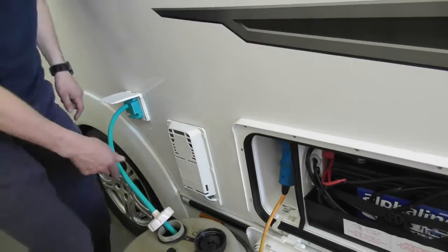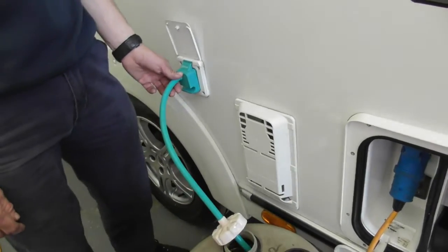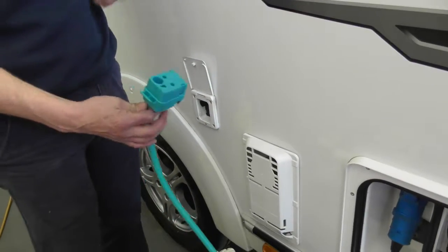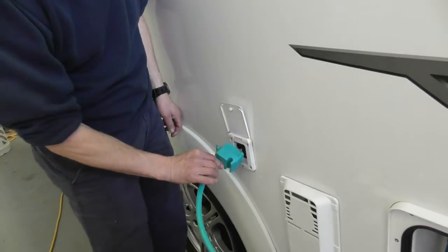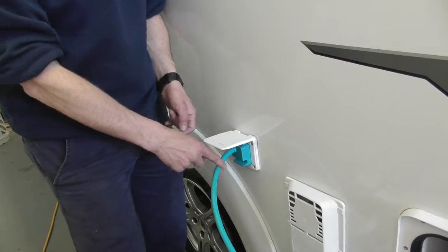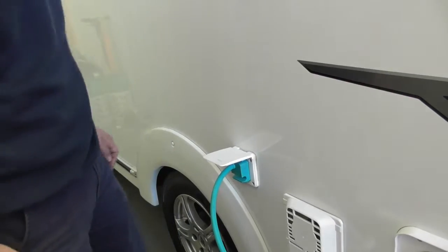Obviously this is your water inlet. So it's just a pipe — the pump is actually on board. So this is your pipe. What you do is just push it in there; there's only one way you can get it in. Push it in and the lid will hold it in position. Don't try to pull that out without lifting the lid — it'll pull the lid off.